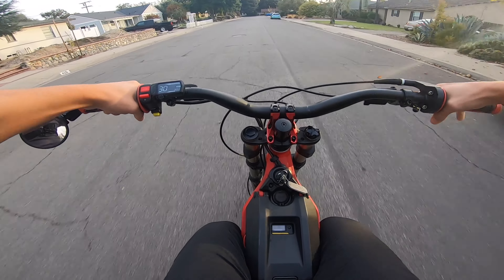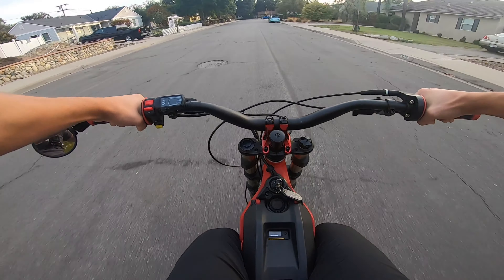Both the Luna and the Magura rotor are floating rotors, which means they have a little gap that helps with heat dissipation. There's something about the design of the Luna rotor that looks super cool — how little there is really holding it together — but that makes me question its structural integrity. Somebody posted on the Facebook page a photo of it breaking exactly because of this design, so I don't know how much I trust it. But it does look cool and it's good for heat dissipation.